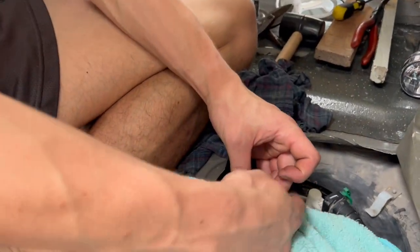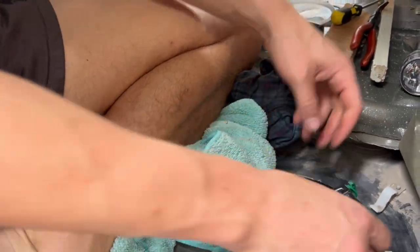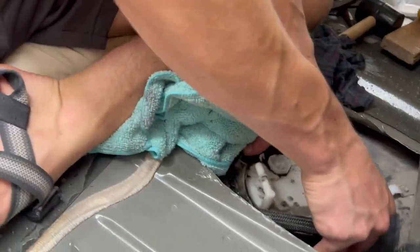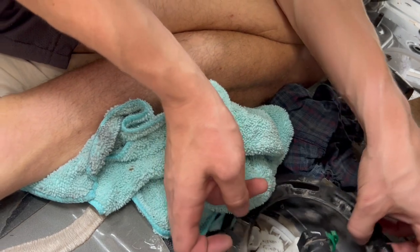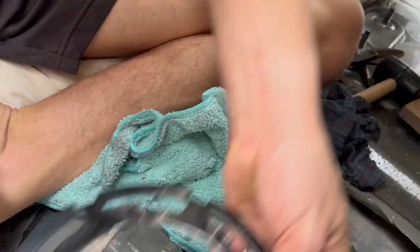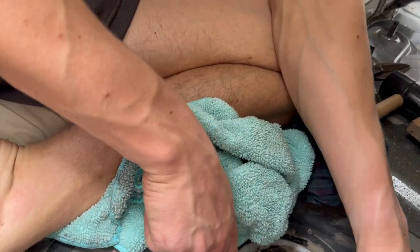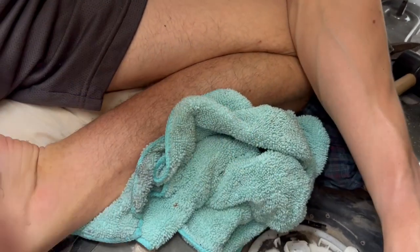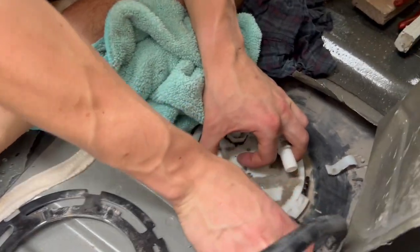A little fuel is coming out of this blue hose. Now we're gonna try and tuck this out of the way completely, undo that lock ring that we loosened earlier, lift that portion off and out of the way — and here we should just be able to lift. Keep in mind there is a float on here, so it's not gonna be just a straight lift.